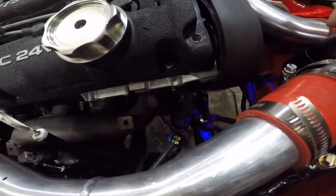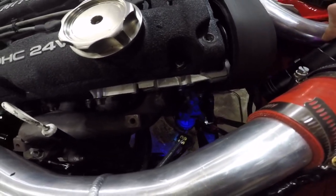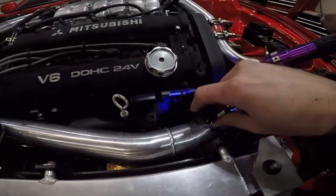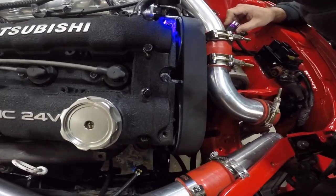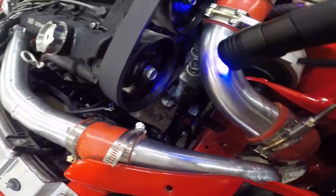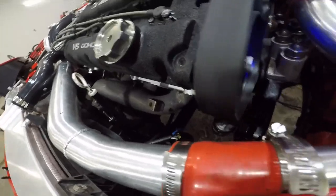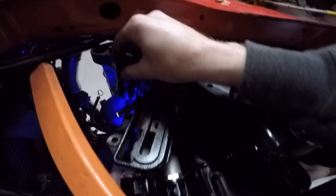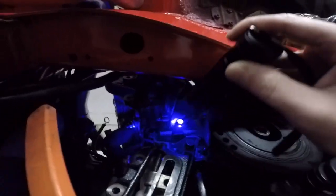You see at the top of the oil filter? Yeah, it's definitely leaking out of this bolt. That quick? Yeah. Wow. Looks like that bolt's dripping right there. Come over on this. Oh yeah, the Allen key bolts? Yeah, they're soaked. All the exhaust manifold bolts are dripping, like a few of you have said. This first one's the worst. Yeah, but we'll take them off and fix them all.